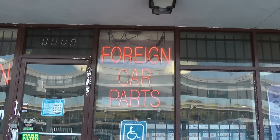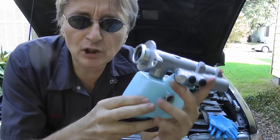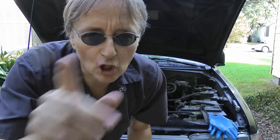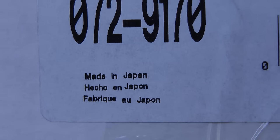So it's time to hop in the old car and get a new one. Here's a mechanic's tip: buy a brand new quality master cylinder — don't buy a rebuilt one, because the rebuilt ones don't last long and sometimes don't even work right out of the box. The cheap Chinese knockoffs often aren't any good either. In this case I got a brand new master cylinder made in Japan, because this is a Toyota.